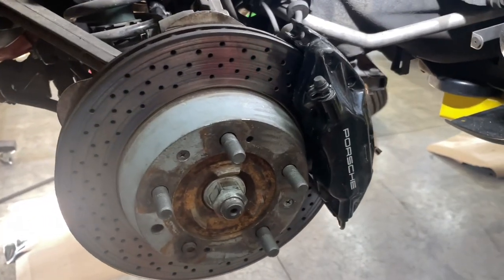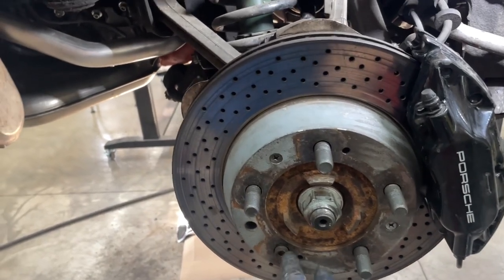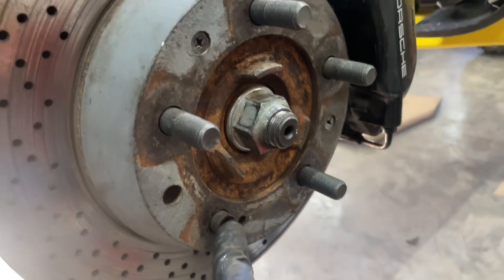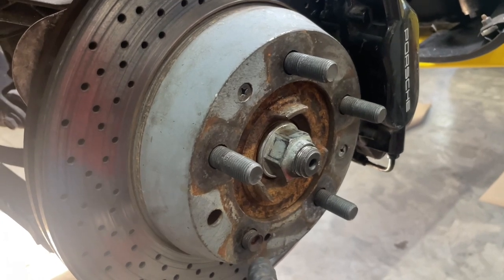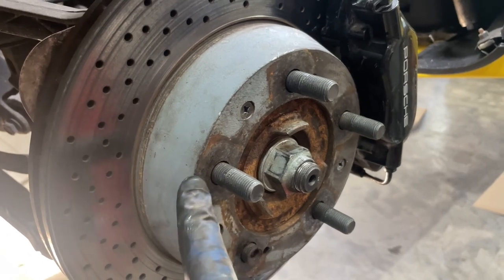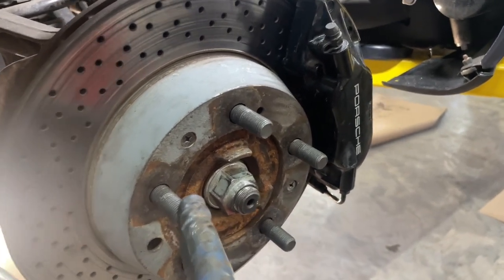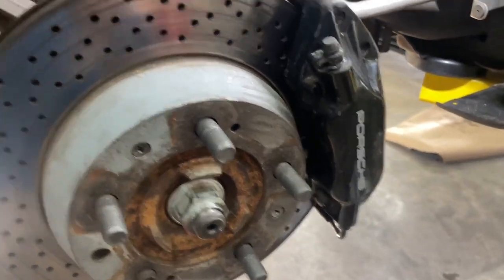The next step is I'm going to take the rotor off. I've got a wheel stud here — when I initially bought this car, one of the big problems was we broke a lug nut completely off. Luckily I have some machinist friends and without damaging a tire, we drilled it out. Now I've got a new one. In order to replace it, I believe I've got to take the rotor off and then disassemble the emergency brake, which is a set of shoes. So we'll have to take the caliper off, take the rotor off, and I can show you what the shoes look like.